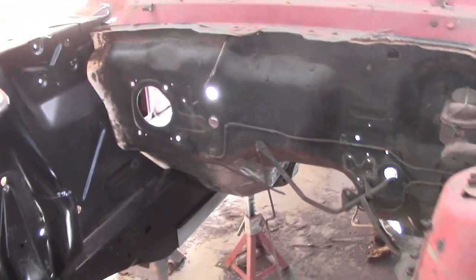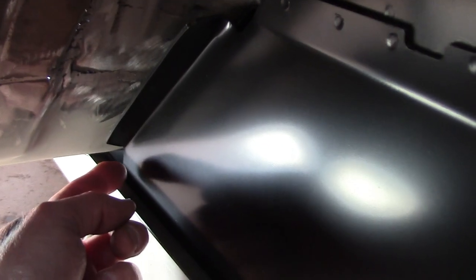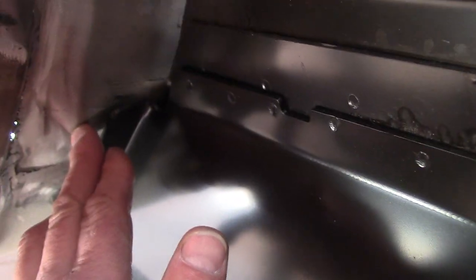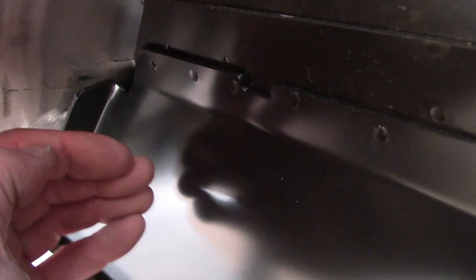So what's the solution to this? If we can get down here and see — see how tight we are? But yet look at our gap. So the solution is I'm going to splice this. I'm going to do a cut here and a cut down here, and I'm going to straighten this out. I'm going to take this piece and hammer it straight. I'm going to cut it here and cut it here, and I'm going to bend it back further. So this lip instead of just being maybe half an inch onto the floor pan is now going to become more like an inch. Because it's the only solution I've got. If I bend that back and cut it back and bend that back, that's going to allow that to move more forward, which is going to close in all this gap that you see going on here. At least that's what we're going to attempt.